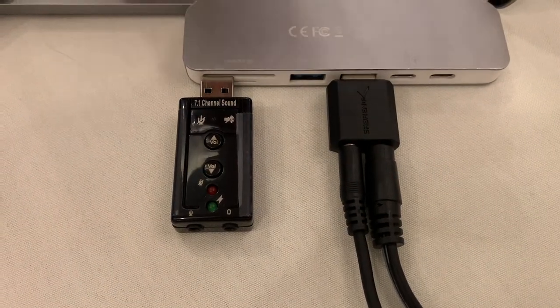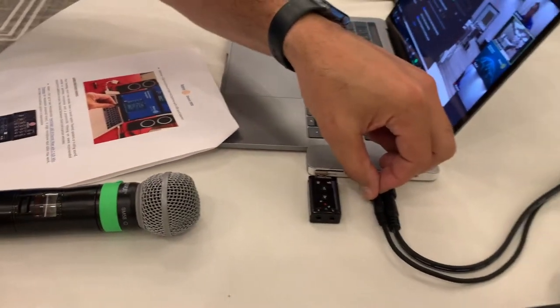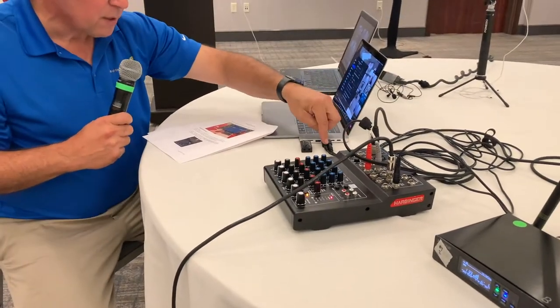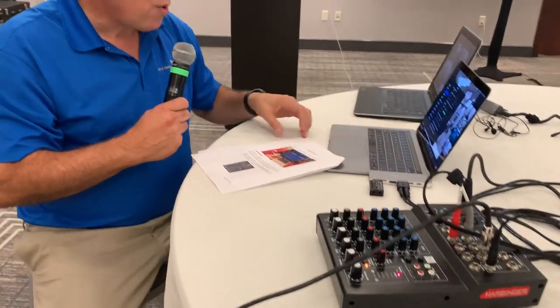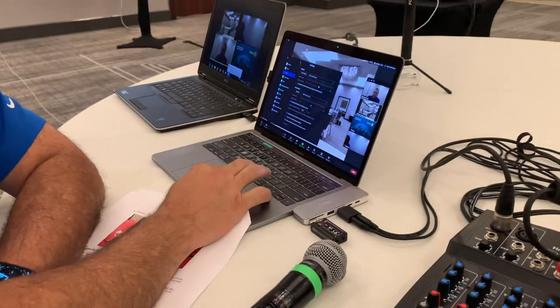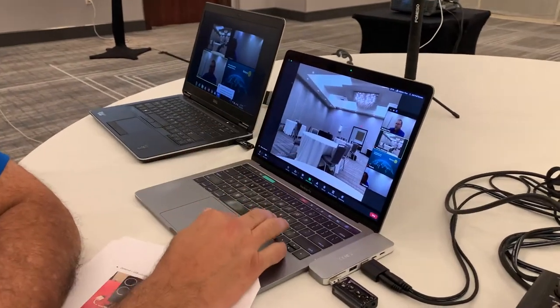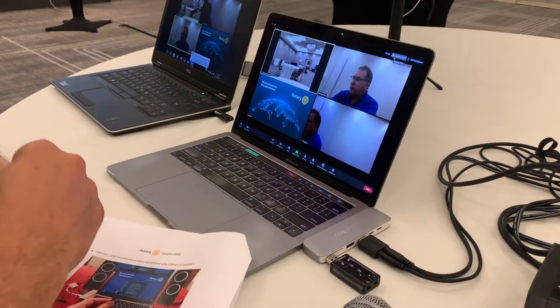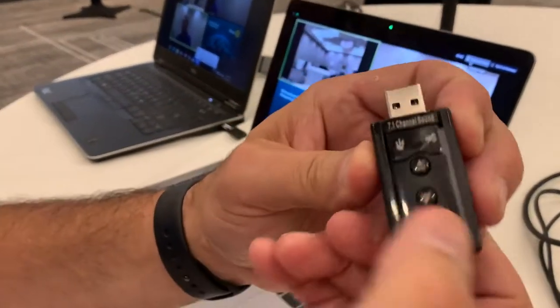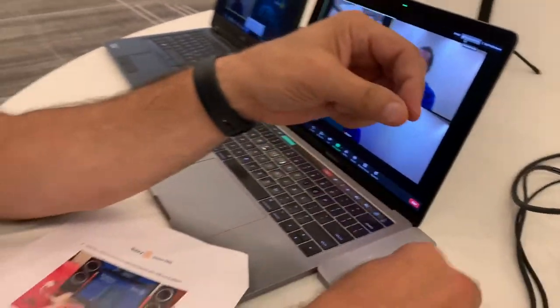Here are two that work just fine. You've got the microphone in. The volume of the sound is auxiliary — it goes into the microphone in, and that is now what is heard by the Zoomers. They are now hearing everybody in the room based on what's on the microphone. When people on Zoom speak, that's going to come through the headphones because Zoom is on. Everything is running through the primary host computer. I can put it on gallery view, and so the sound comes out of the headphone jack — microphone in, headphones out.